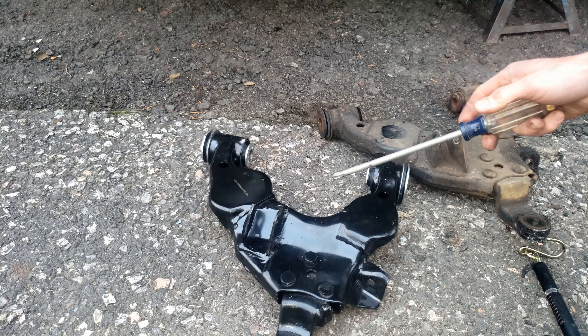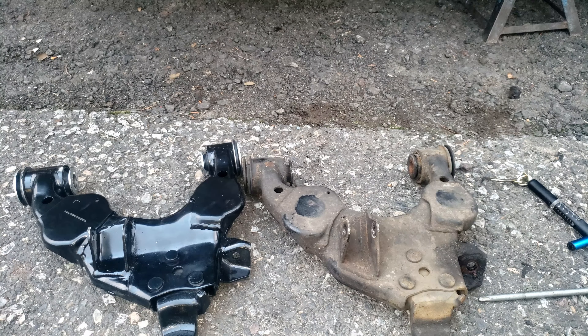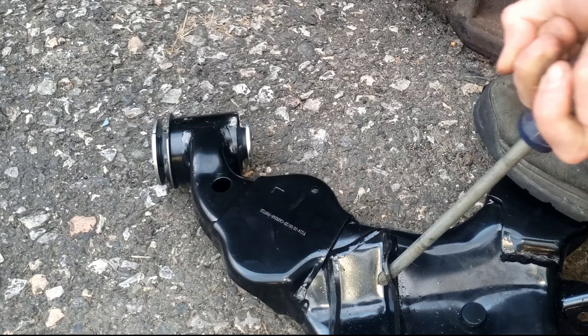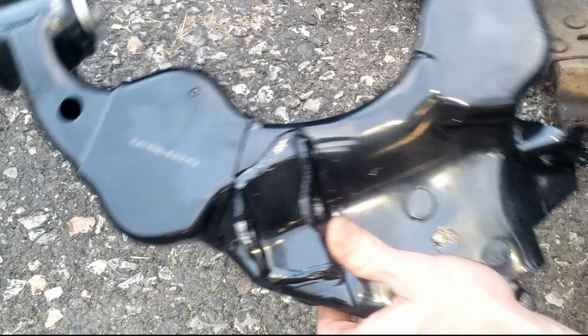It's Chinese steel and I'm not going to use these. I'm going to get the OEM bushings — I want to keep her all factory. What was I even thinking? I'm already putting an aftermarket rack in it and already had problems with that. I'm not going with the Chinese. It's just so darn tempting — $125 and you don't have to go pressing bushings. That's the option for most guys, but just based on my experience, I'm not going to do it. Let me show this comparison one more time: one quick hit on the Chinese one — boom, look at that, see how much that bent over. And the Toyota one — I'm pushing on that way harder and it's not bending. That one flexed right over. So you can imagine if you go off-road and bash a rock with this thing, it's going to twist like a damn pretzel. Stop putting lead in your steel, China. It's weak garbage.